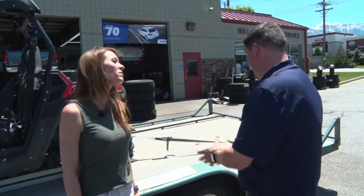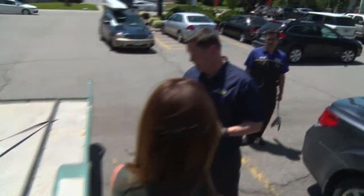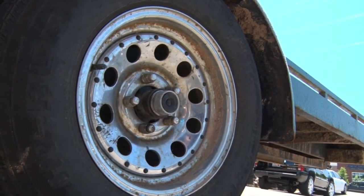Basically, all you really have to worry about is this area here and both axles — the driver's side and the passenger side. Tires are the main thing you're going to check, and then the wheel bearings to make sure they have enough grease, because that tire spins fast going down the road and generates a lot of heat. If it's missing grease or low on grease, you have a chance of burning up that bearing and causing an issue on that side or the whole axle.